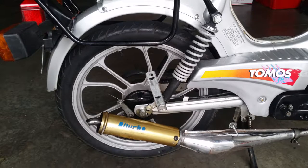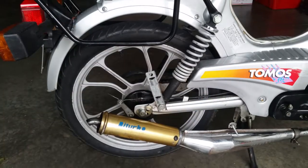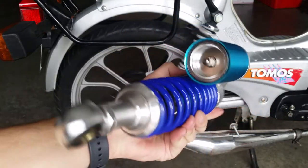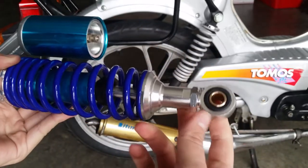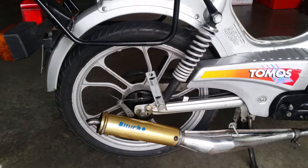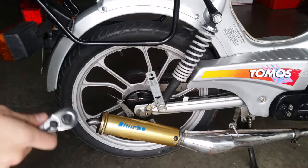What is up guys, another moped video. Today we're going to be changing this to this — a nice new suspension. This whole suspension straight here, I don't know what happened to it, but apparently it's gone now. This is nitrogen gas adjustable suspension, something new, try it out, see how it goes. There's the canister, you could adjust the spring with this, and you can adjust the ride. I have 20 millimeters of play. The bolts on this bike are 16 millimeter, so let's take them off.